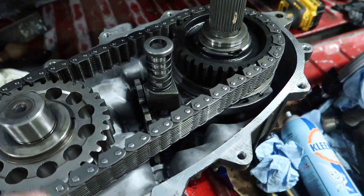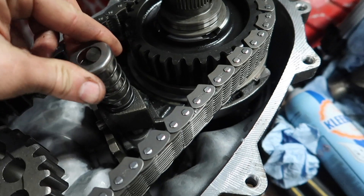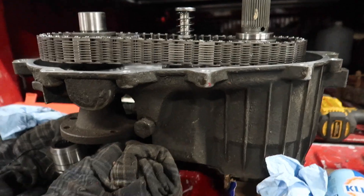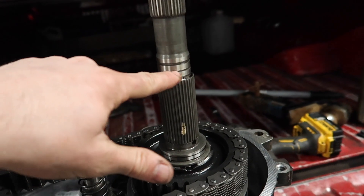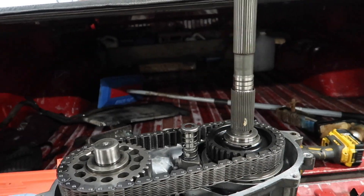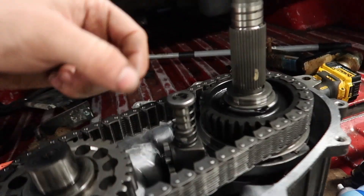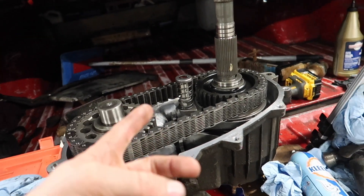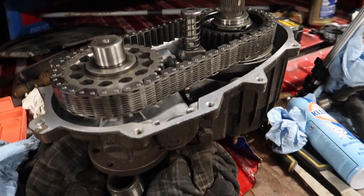Alright, so now with your case down here, make sure you get your magnet in again, snap ring on, and your spring and washer. You'll notice the chain is kind of off-center — that's because when you have the tail housing on, this gets pulled up and held with that snap ring you took off during disassembly. So if you're trying to shift it now, it won't work. I double-checked everything against the manual on the computer and everything's in order.